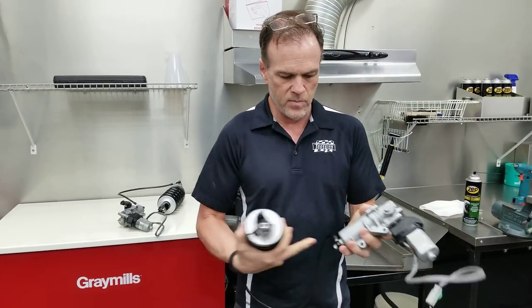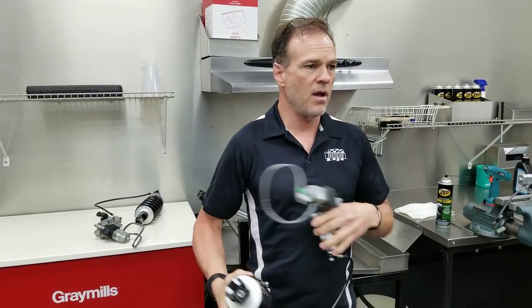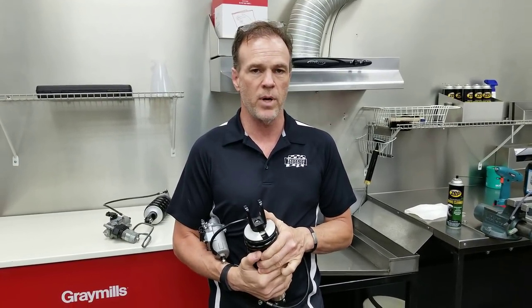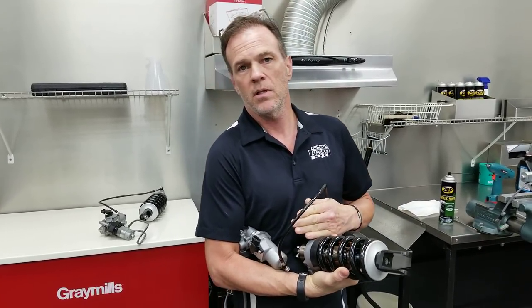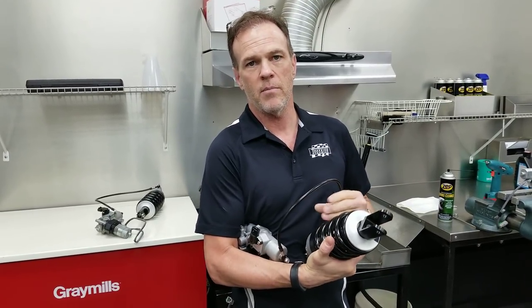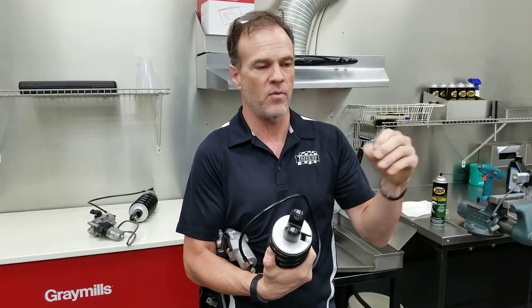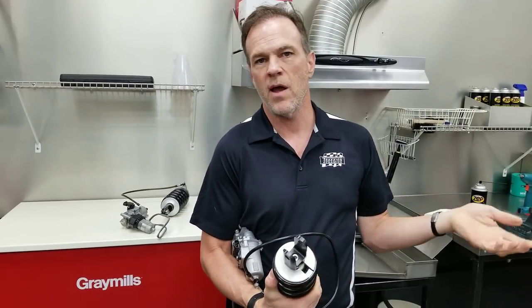The bike comes with a soft rubber line. In the application of a shock absorber, it's very much like a brake system, where lots of sport bike riders will add a braided stainless line to get better feel out of their brake system. In the application of a shock, once the slave cylinder leaves its pocket and is sitting on oil and is no longer bottomed out, as the shock cycles, the spring is putting pressure on that piston in the cup of oil and it's cycling the rubber hose millions of times.